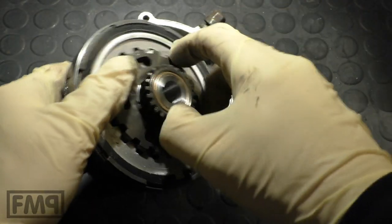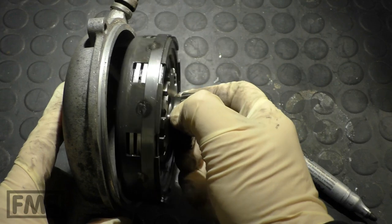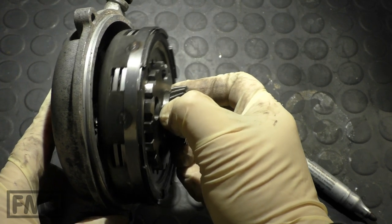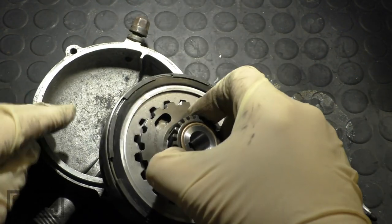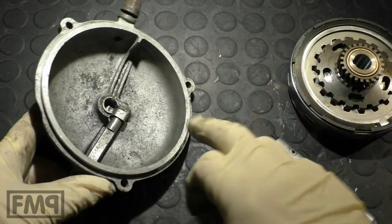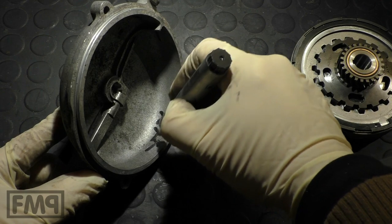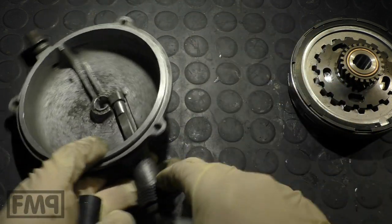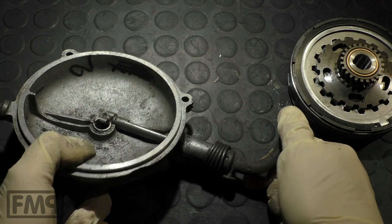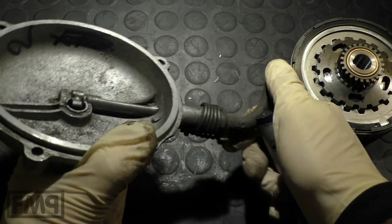Number two: because it's quite narrow with an original clutch, and now it has an additional ring, the clutch sits in here and it doesn't run 100 percent straight and smooth — it wiggles a bit and the bearings get more tolerance. So we need a little bit of space between the clutch lid and the clutch basket. I'll show you this when the beam is removed. We make a little bit more space here.